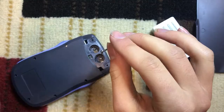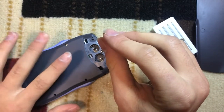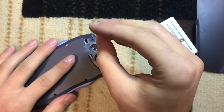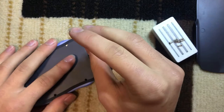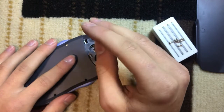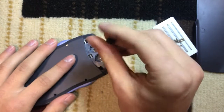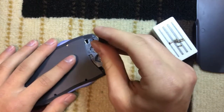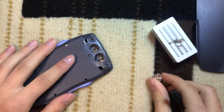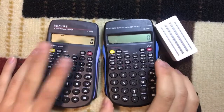I'm gonna pause. Now, quick side note. When you're putting screws back into plastic, make sure to back it up slightly till you feel a click. Back it up, Squidward. Wait, no. And then screw it in. That's to help use the original thread and not just create tons of new ones and chew up the plastic. Alright, he's back together.